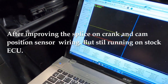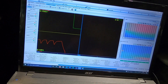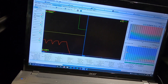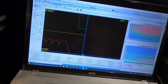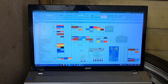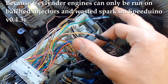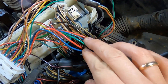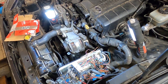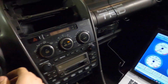The engine is running and the Speeduino sees all the parameters — it's syncing. All sensors are being seen by the ECU, so I think it's time to swap the injectors and ignition coil signals over to the Speeduino and see if it starts standalone. I referenced my Excel spreadsheet with the color-coded pins as well as the manual, and now I've got the injectors paired as they should be and the ignition coils connected. Everything related to the engine is now connected to the Speeduino — it should start right now. Let's try.